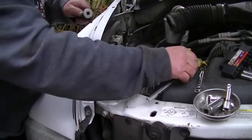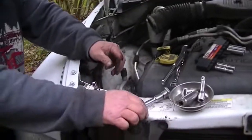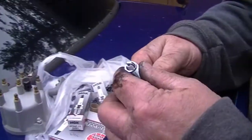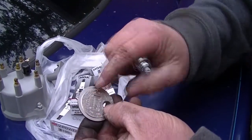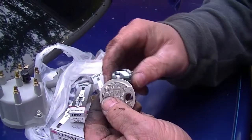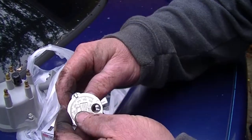I'm going to put another plug in the second hole. We're using NGK plugs and you're supposed to gap them to 40. They don't come pre-gapped, so you get this little plate, look at 40, and put the spark plug up to it to check. We're at 40, so we're good. If you have to adjust, there's a little dial — you can bend it so it's snug and it'll stop at 40. Done, you're good to go, ready to put the plug in.